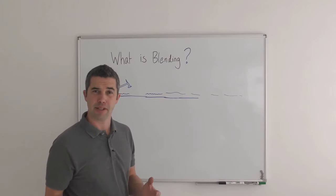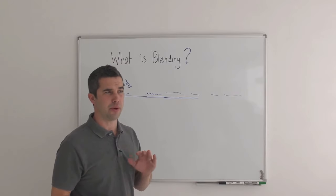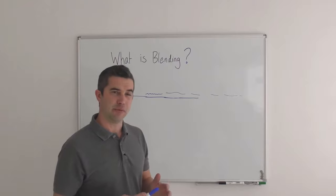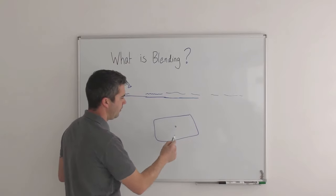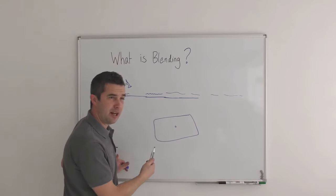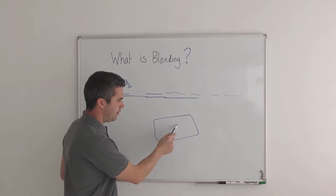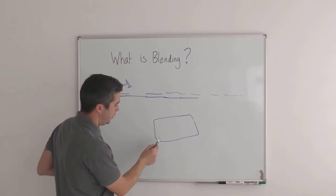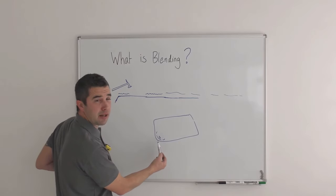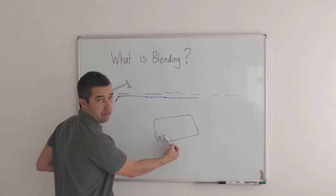With steel it's got a memory to it so it wants to go back. I don't think it would be as effective with aluminium panels, and also it's quite difficult if your dent is in the centre of a sheet metal - so the centre of a roof panel. Trying to blend there is going to be a lot harder and probably less successful because as you're tapping you're creating those waves and it's got such a big area to go across. Whereas if it's on the front corner you're really focusing that energy, bouncing off these bits, because you'll get a certain part of the energy waveform that will come as far as it can go and then to a certain degree travel back on itself.